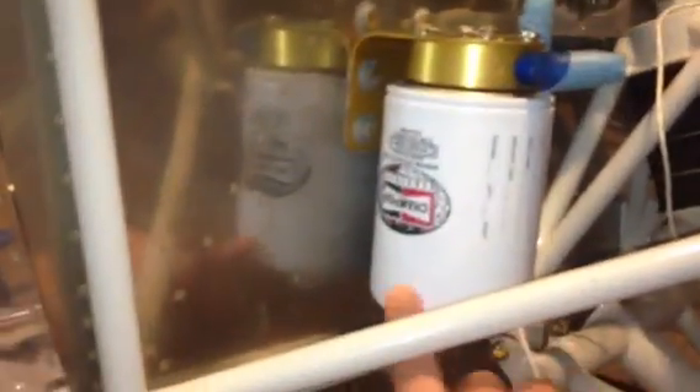I put a doubler plate behind it. It picks up the structure here and also picks up structure on the center side. If I pull back and move my filter, you can see there is no play in the firewall at all anymore. There's actually a rubber piece that gets installed in here later on that the oil filter nestles into, so even this play is removed at the end of the day. All this is gone, but the firewall is absolutely solid.